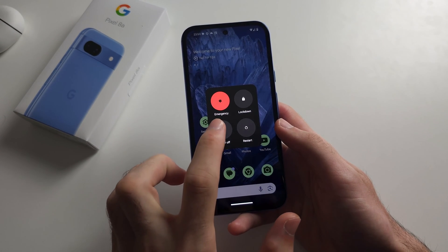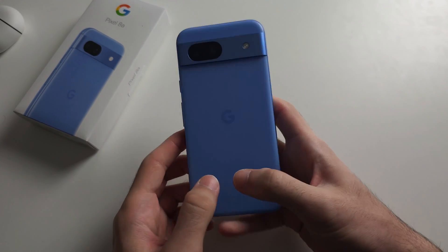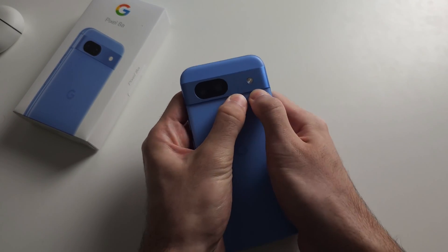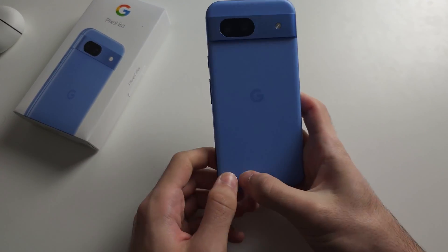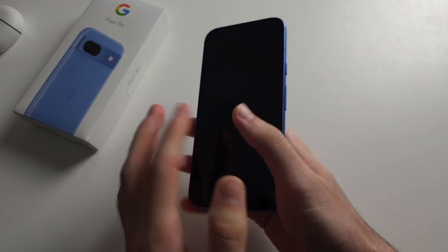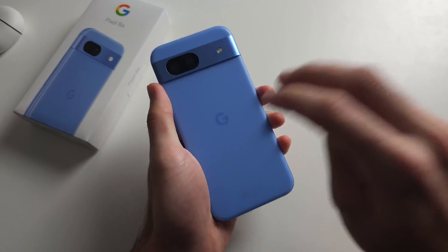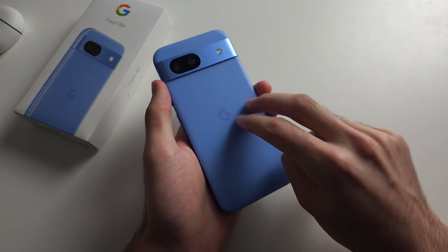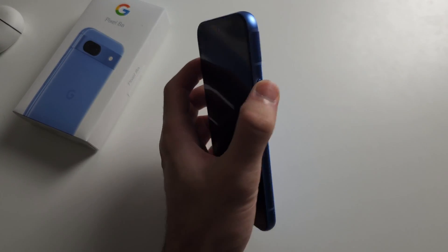And if all else fails, power off your phone. Get two fingers and push really hard all the way around the back of the phone — the speaker cable may have unplugged, so we're just trying to push that back in. Do the full back, do the front, maximum force. Then with two fingers, tap really hard all the way around the back of the screen. Maximum force — you won't break the phone. Then turn on your phone again.